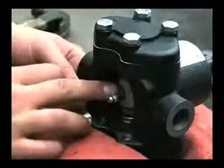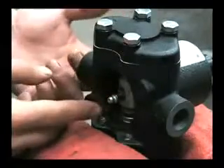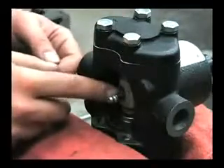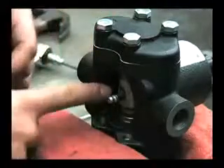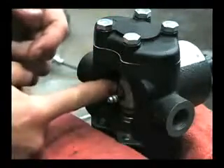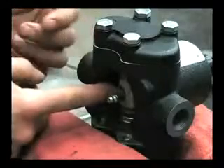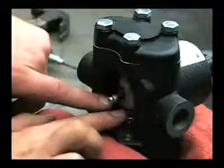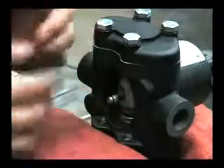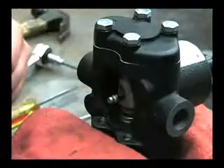You'll want to grease this cam bearing every 50 hours of operation or once a month. Be very careful not to over-grease it, because you can actually blow out the inner seal that's inside of the cam bearing. And if you have excessive grease in this cavity, it'll build up heat. So be very careful with that.